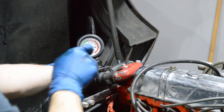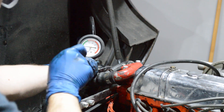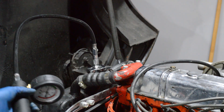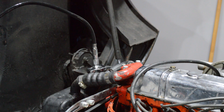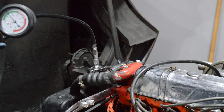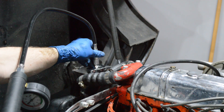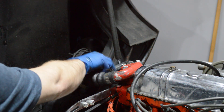Obviously without the coolant it's going to take longer to pump it up and it's going to go a little bit higher. Now in theory — and this is what we're going to do — it's at seven PSI. I'm going to leave it there so I can come back in a few minutes and make sure it hasn't lost any pressure. All right, we're back and we're still at seven PSI. So the system is no longer leaking and we can get this thing back on the road soon.